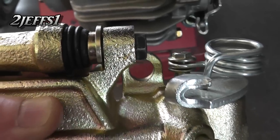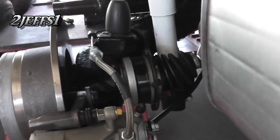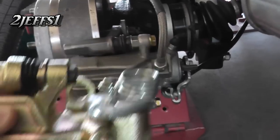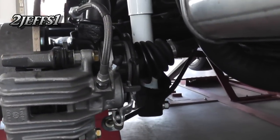This is where the emergency brake comes through on this caliper too — it kind of comes over the top of your axle. I really didn't care for that. So the one that I chose goes around and underneath, and you can route it real nice.